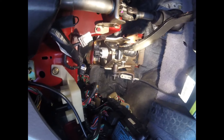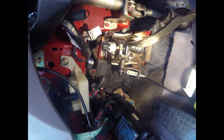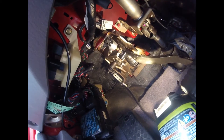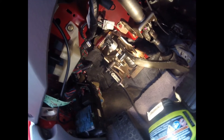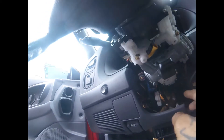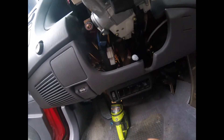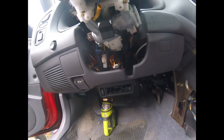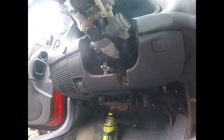Now all I have to do is take off four bolts to take off the brake assembly. I'm going to have Randy come over and take it out so I can know I'm doing it correctly. Then I'm going to work on the clutch master cylinder — drill two holes in the engine bay and put that in. I'm almost done with the inside. There's also a cable right here that it said to detach — yep, that goes to here — so I can take that off and just knock all this stuff out to make this a manual.